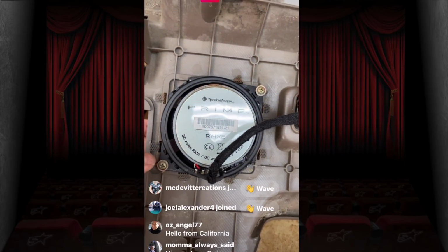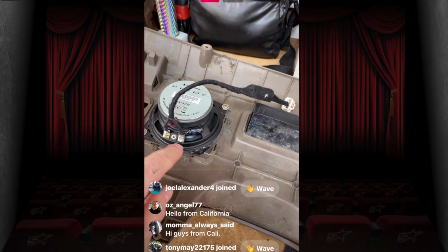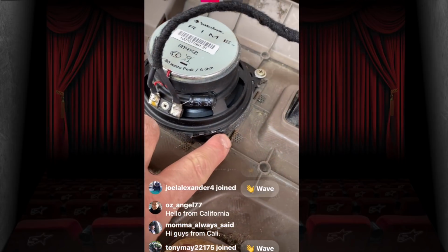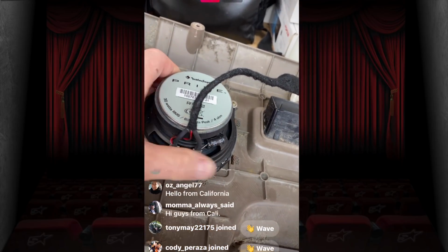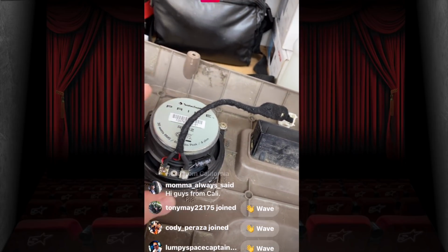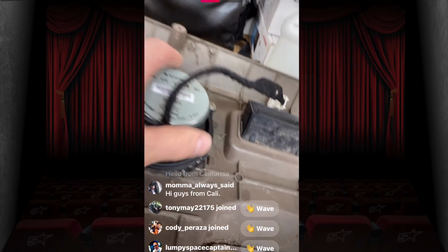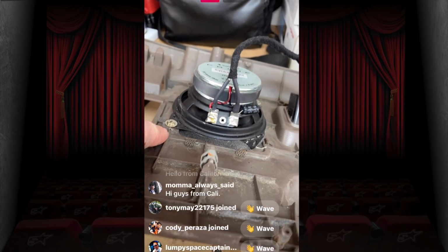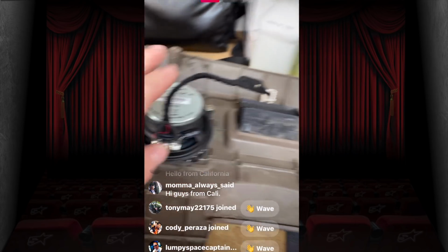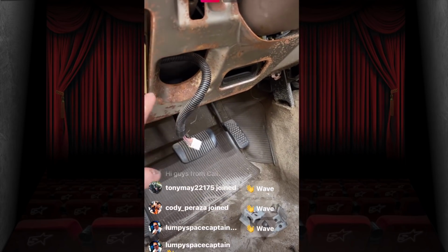And that is it. In this particular one, if you notice, they have these cool little ridges on them right here. These are designed to be cut off. And there's only 2 screw provisions on this factory one. So what I like to do is actually bend them so that the speaker doesn't rock. And if you can see there, we also put foam in. We cut these a little bit shorter to get the driver in, because in the dash there is this area here.